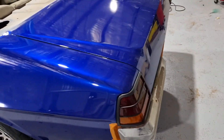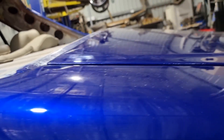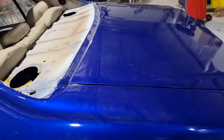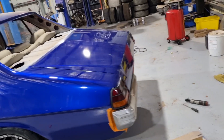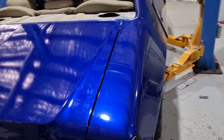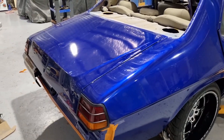There we are, got my sand line and my 10mm each side marked. Now I'm going to cut that out and put it up there and see what it looks like. Just playing around and whacking the boot on her to line it up. We've got a shim in the boot — it looks a bit high at the minute, so we've got a 1.6 shim in it. We'll pull that out, put a 0.8 shim in, drop the front of the boot down. It's looking alright — looking okay. Loving it.